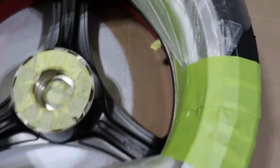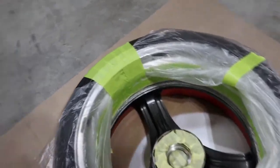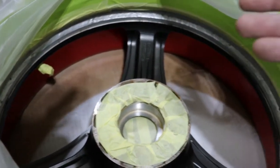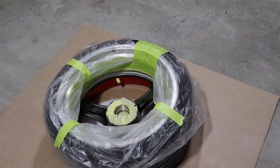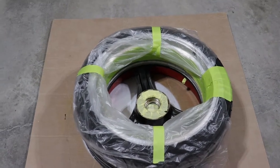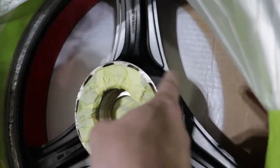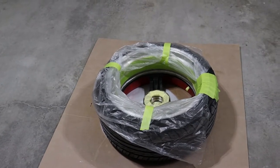This stuff says on it that you're supposed to put 10 coats on it. I basically ended up just using one full can per wheel. But what I'm doing is putting a couple of coats on the inside first so that it just turns out a lot cleaner when I actually coat the outside. I would do the whole inner part of the barrel, but I don't have enough paint for that, and that's okay for now. So just a couple coats on the inside, and then when I flip it over and do the outside, it turns out so much cleaner because from certain angles you end up seeing the back pieces, like this inner wall here and here. And if I only sprayed it from the front, I can't get that as good. So we'll just continue with the other three wheels.